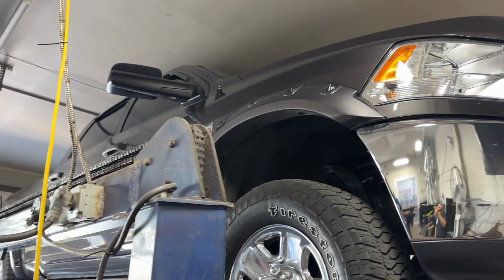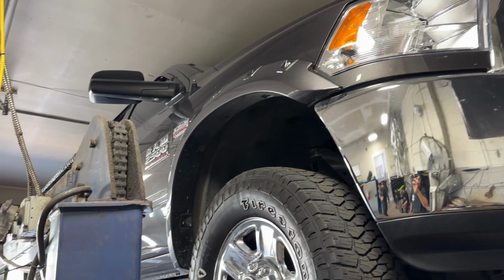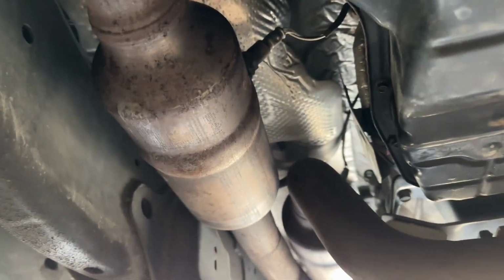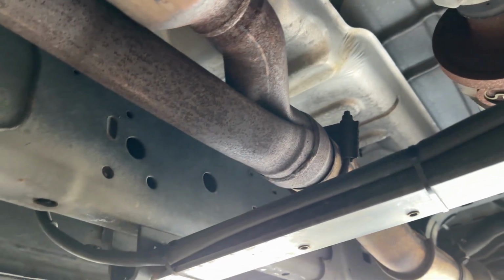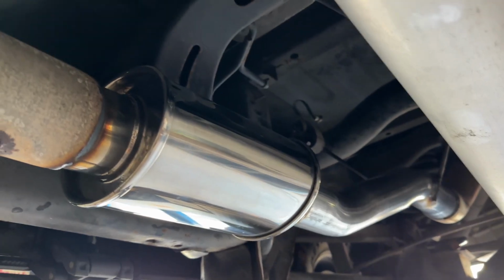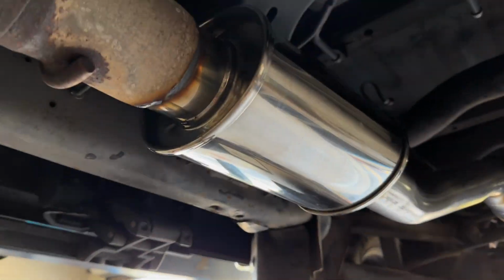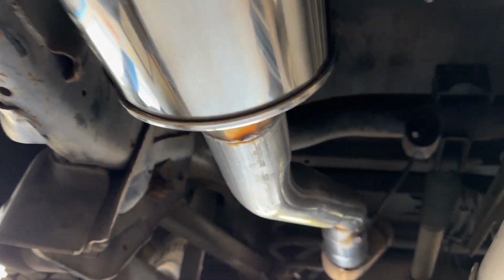So you guys saw what it sounds like and looks like before on this Ram 2500 HD 6.4 liter HEMI. Let me show you guys what we done after. So still got the factory converter there, secondary another converter there, then it winds into a single there, and then 3.5-inch pipe goes into a Vibrant Ultra Quiet, 3-inch in, 3-inch out. That's what the box looks like. There'll be a part number in the description for it.